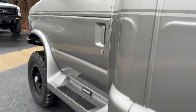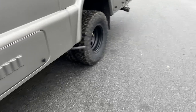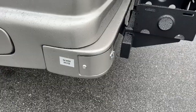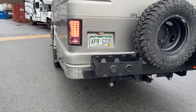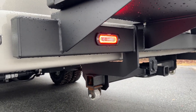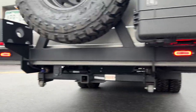We have an S-pod controlling all the lights, the OBA, and a reverse override. We do have onboard air on this rig — it's mounted up under the rear. Out back we had a bit of a challenge figuring out what to do with the bumper. It has a really nice molded bumper in the rear that also holds the poop pipe, so we didn't want to eliminate that, but we also didn't want to completely replace it because it matches the body so well. So we made brackets to attach to the frame and made another bumper — kind of a double bumper. Buried some Rigid reverse and marker lights in there. It's got a little open box on the driver's side, spare tire in the center, and a Pelican on the right. Turned out really nice — super slick.